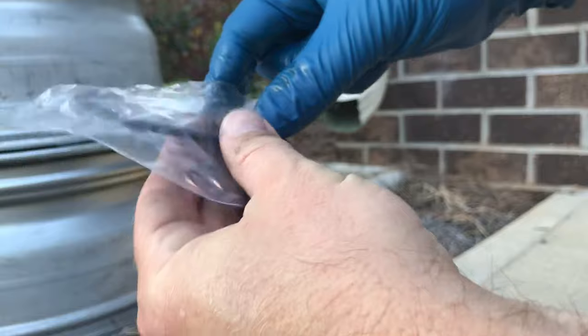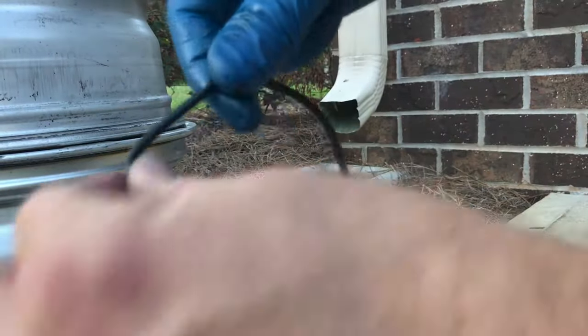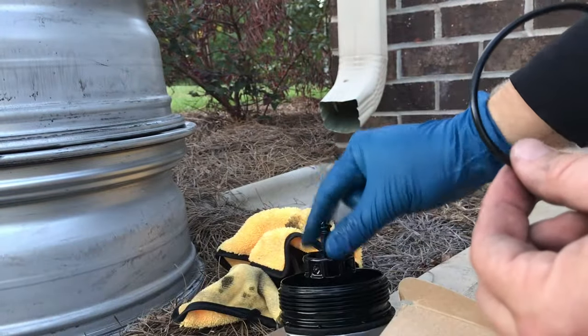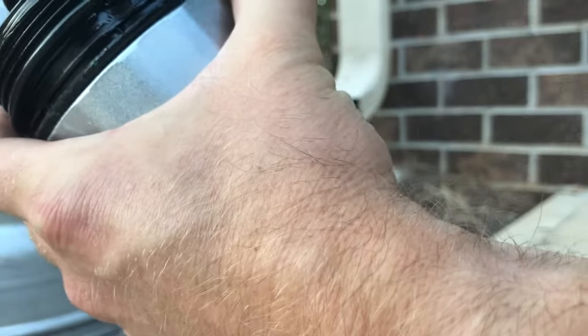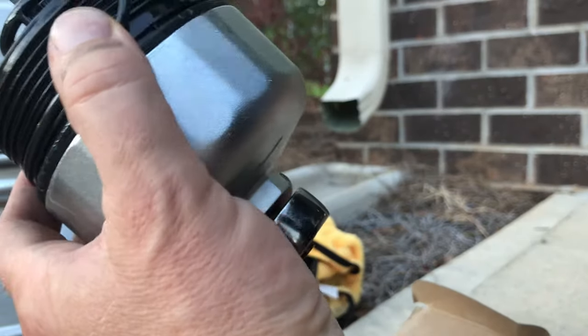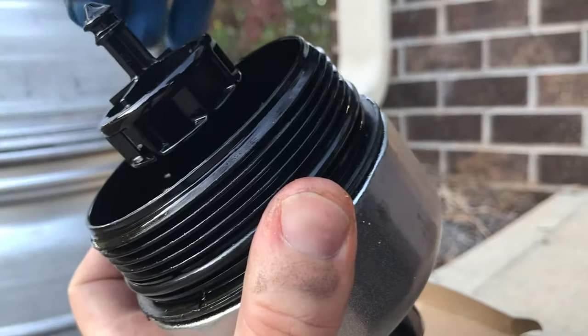Open the bag. There are two O-rings, and it's also good to get a little bit of the oil on them so they make a good seal. I'm just grabbing some used oil off of this one and putting it back in the same groove that you got the other one off of. I can show you there's one groove that's wider than all the other ones that this one fits right in. The other grooves are threads, so you don't want to put it on the threads. You put it down here in the groove, and then